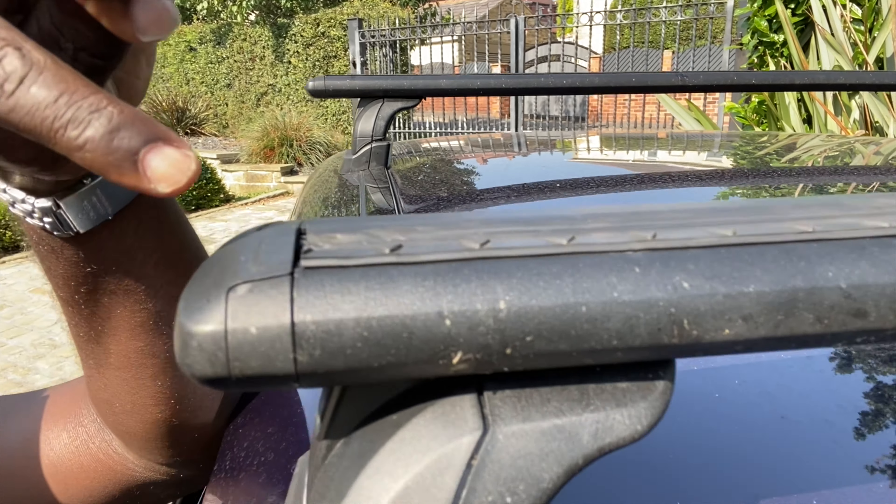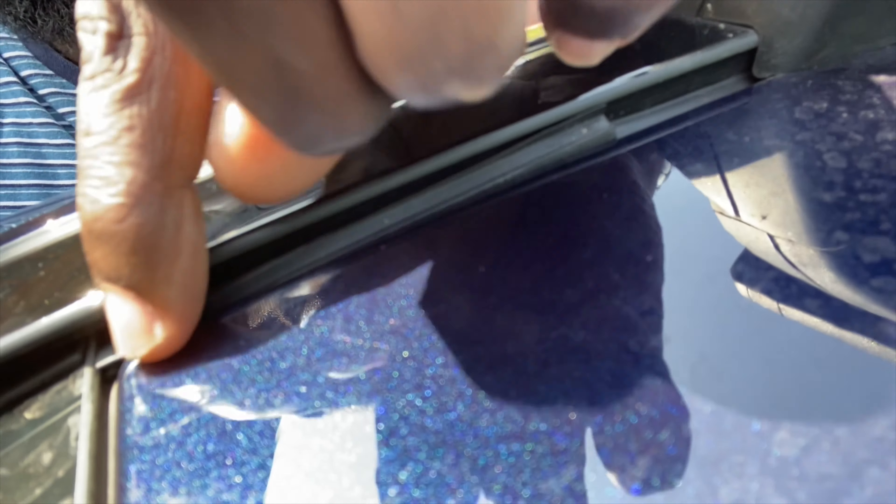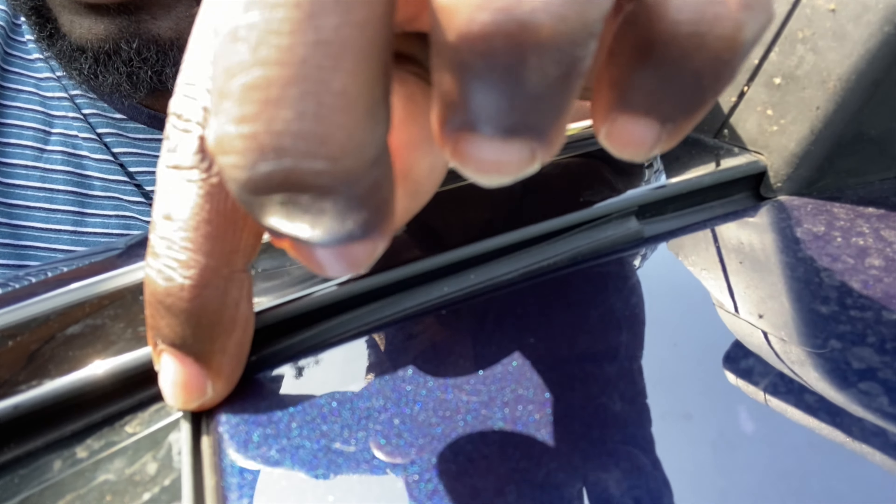What I've done is taken some leftover rubber strip from my old bike rack accessories — usually they give you a very long rubber strip to put inside the bike rack. I've cut out a piece of that leftover material. You can see from here to there it's a new rubber strip. I can actually remove it — I just wedge it in like that, making sure it covers this little gap which I suspected is causing the exaggerated wind noise. Because the car is so quiet, any noise that is out of the ordinary can be picked up.